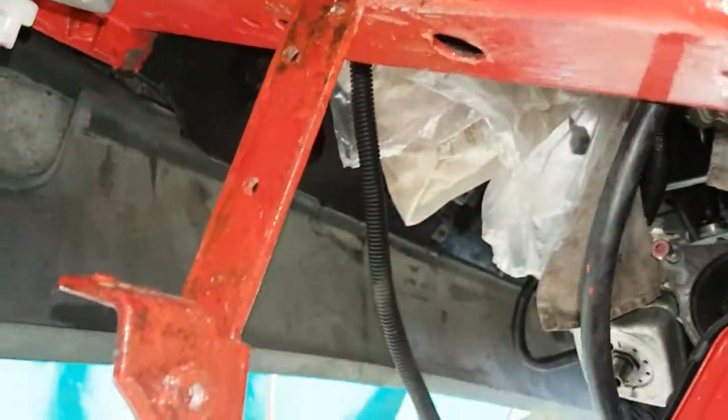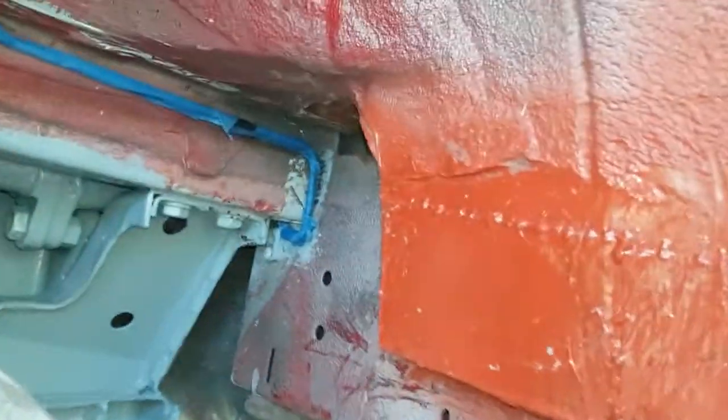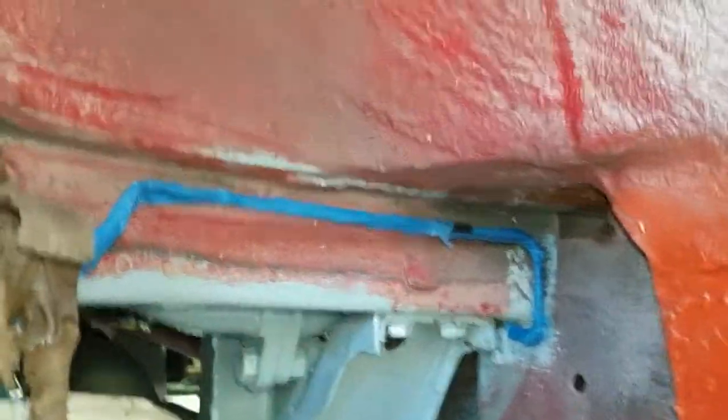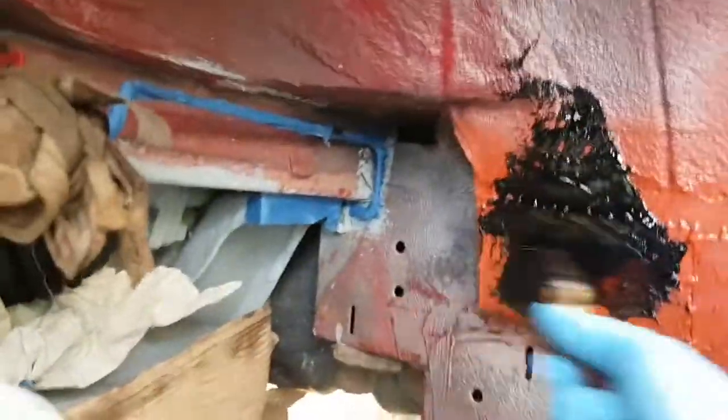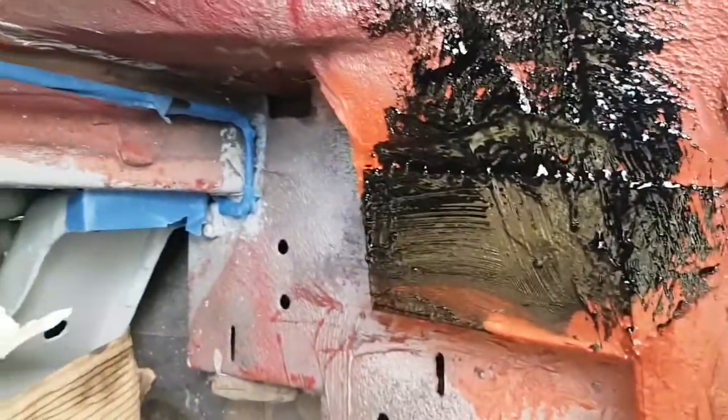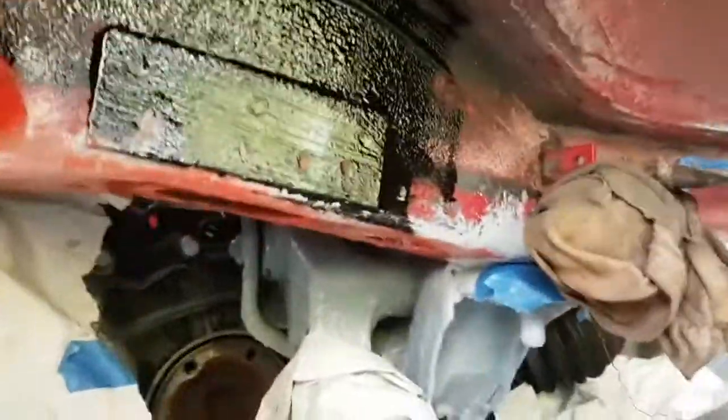Where the old fuel filter is - I'm going to replace the fuel filter so I'm not fussed. It's had welding here before, so I'm going to black all that up with the bitumen - the whole lot all round here like I've done the other side. I'm going to cover these bits up because obviously they're all good. I kept putting a bit of just motor oil on it to keep it overnight. Bitumen paint - roof paint - nice and thick. Just go over everything. I might do two coats of this, but pay particular attention around the arches - load it on heavy. You're going to have to cover everything up like I've done. It's really good stuff - you get a nice finish from it.